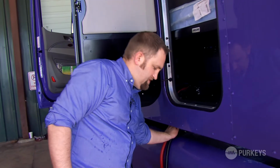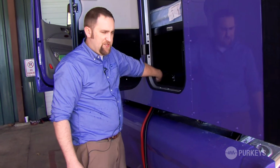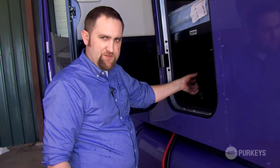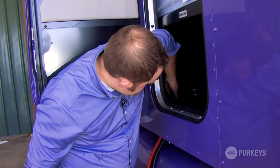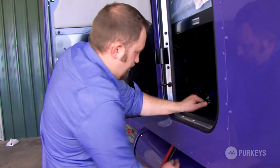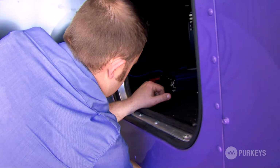Now that you have the cables out of there and secured to the inverter, you want to make sure and tighten down the dome nuts, the strain reliefs that are holding those cables through that pass-through. So we're just simply turn those dome nuts clockwise. You may have to hold it from the bottom side to keep it secured.